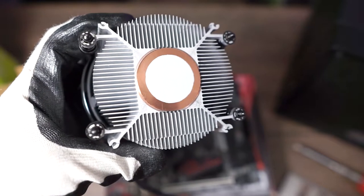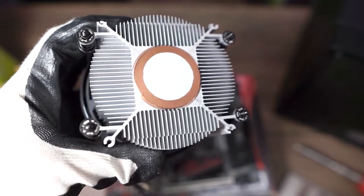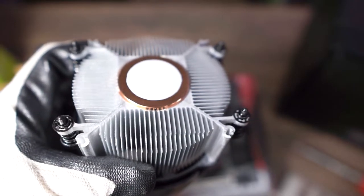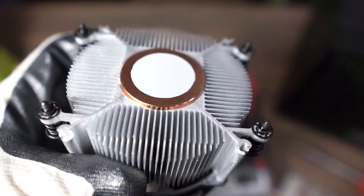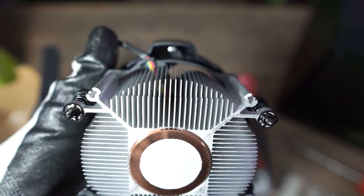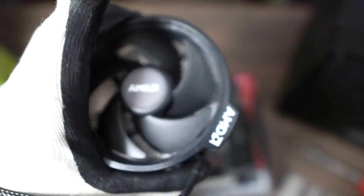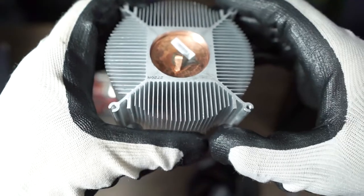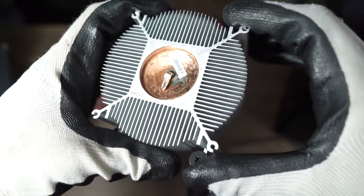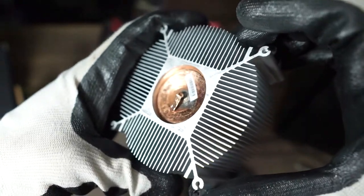Great job AMD — I thought you were actually going to use the exact same cooler for all of your CPUs, but surprisingly this X variant has a copper slug in the middle of the heat sink to help dissipate heat. Great attention to detail. Now if you wanted to rotate the fan shroud you will need to unscrew the screw underneath, giving access to the four screws on the corners to rotate the entire assembly. One interesting thing a regular person may not notice is that the copper slug they put in didn't even have the pigtail removed.